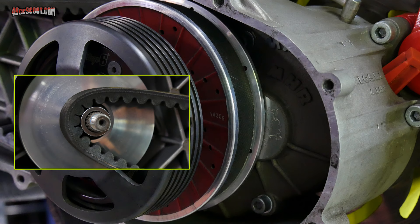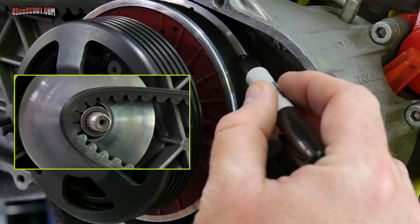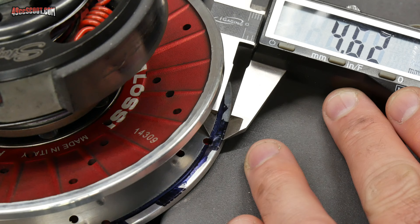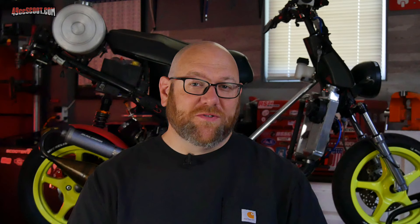Here's a look at the Molossi belt installed without the fixed half of the front pulley — an easy way to see the full potential for low gear belt position. A CVT doesn't have set gears, but the travel here functions like low gear, providing the greatest torque multiplication for low speed acceleration. The Molossi belt is about 4.5mm away from the outer edge of the rear pulley, while the Polini belt is within a millimeter from reaching the outer edge — clearly showing more potential for a low gear ratio. The longer belt should also have greater potential for high gear ratio and perhaps more top speed.